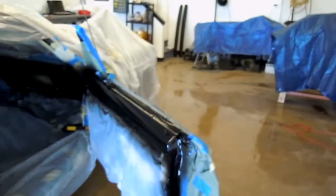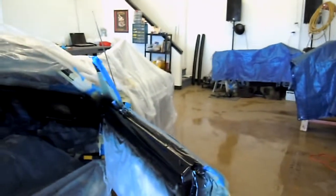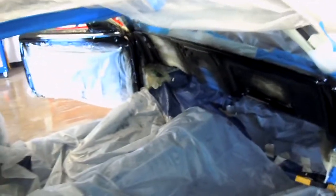So let's check it out. I did everything possible short of having a booth — I had a wet floor, I had a spray suit, cleaned the entire shop, soaked the floor down, mopped it twice, masked the car off, triple masking on all panels — and it definitely paid off. The difference between that and before is stunning.